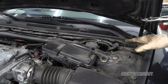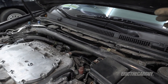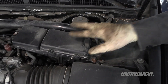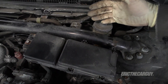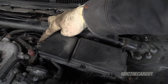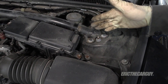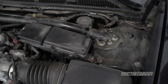It is not necessary to remove the upper strut brace. However, it is going to make access to the back of the engine much easier without this in the way. In many ways, this is easier said than done, because this fuse box is attached, and there's another bracket back here that's attached. So you need to remove this 10 millimeter, this 10 millimeter on the fuse box here, this 10 millimeter on the fuse box here, and then there's still another clip to undo after we remove those. So we'll start by removing those three 10 millimeters.